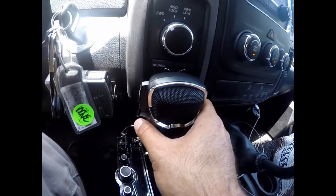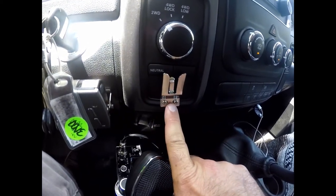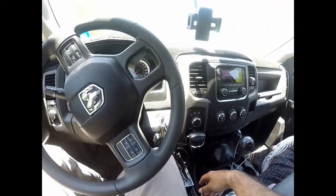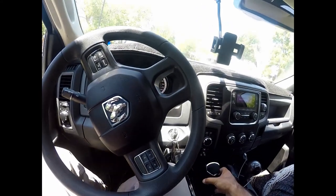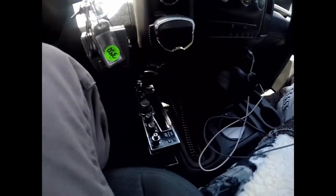It's a three-foot fire stick with a 10-foot coax cable routed kind of the same place as the power cable — up behind the dash where it stays fairly straight, since you're not supposed to coil coax cables. The stock microphone I just mounted right there on the side. It might look rough when removed, but it's really convenient to grab when you're sitting right there driving.